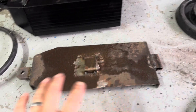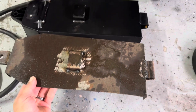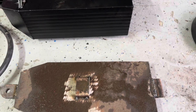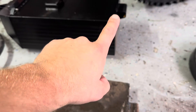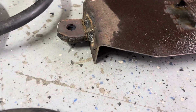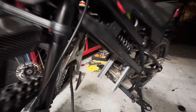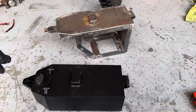I got that one tack welded — these are all tack welded — so here we got the rough shape, an exact copy of the back side of the original battery. Let's see if it fits. We basically copied that bracket and bent out the same piece. Middle one and the front, we got a pretty thick half-inch right there. We got a little bit of progress — this whole plate is mounted in here.